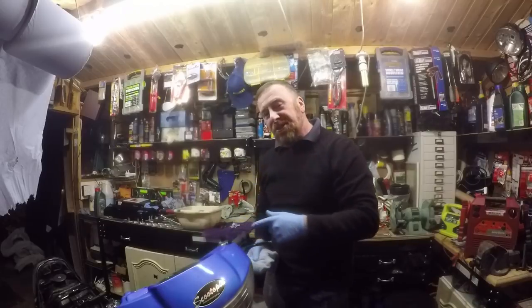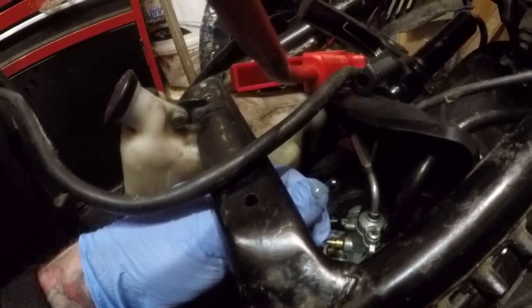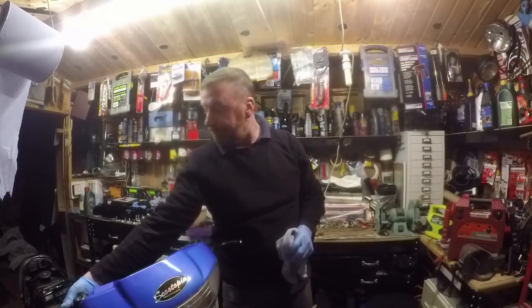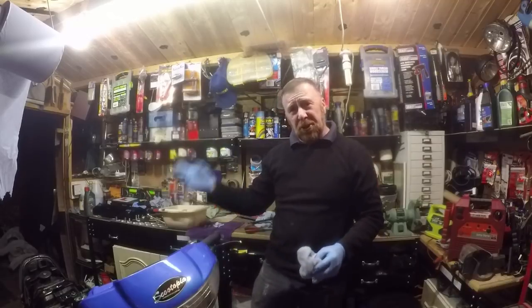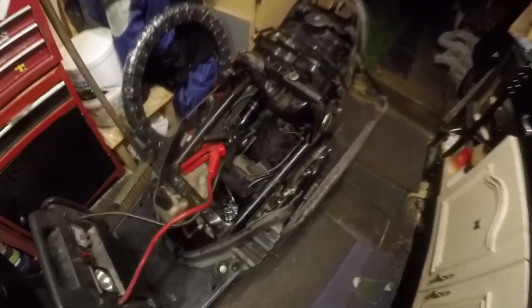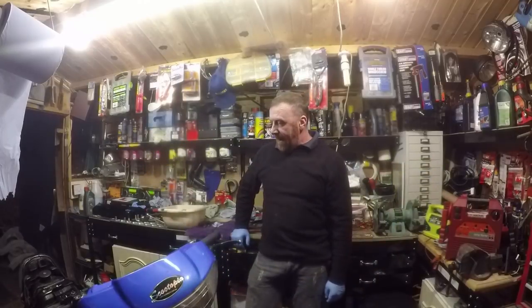Bike all back together again. I was testing the old pump — let's see the actual pump working. And there we can see little tiny bits of oil dripping out of it, which means it's working. Let's pop that back on — make the bike happier. There we have a much, much happier running bike. It's going to get some of the old crap out of the exhaust, because obviously it had too much 2T put in as well — too much 2T is not good. And that was really bad petrol anyway. And there we go.